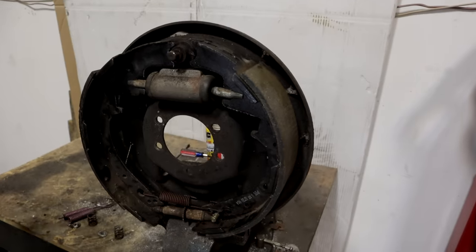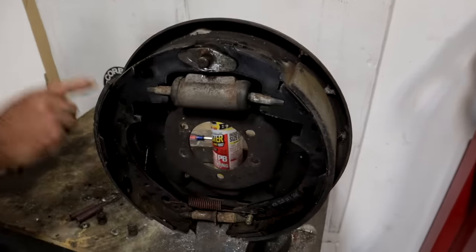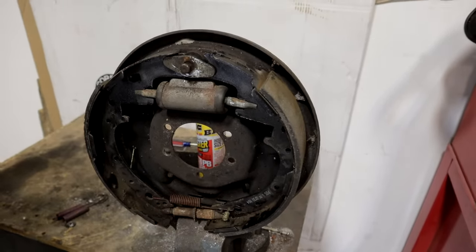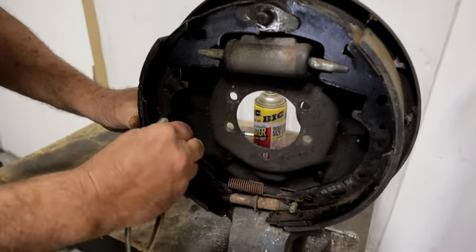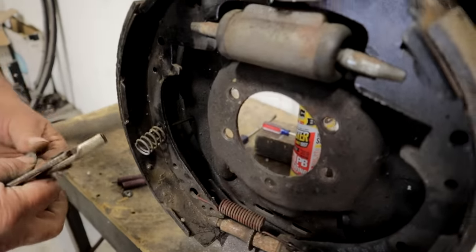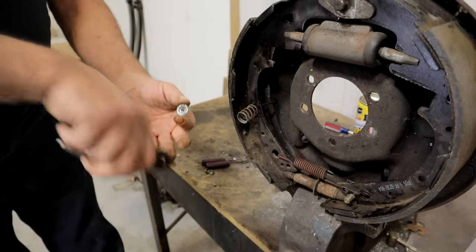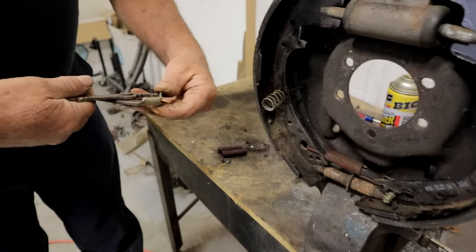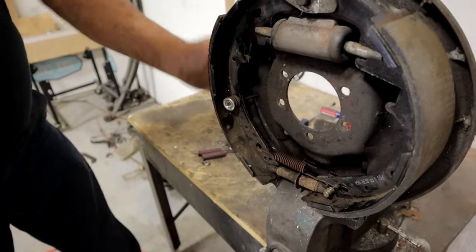Let's put this thing back on there - very important piece. Once you've got them on there, stick your anchor pin through, turn the flat spot straight up and down, hang your spring. I use just a simple pair of pliers. A lot of guys like to use the special tool - I think I've got a couple but I've never used them. Just take a regular pair of pliers, line up your slot so it's straight up and down, push it on, quarter turn, you're done.